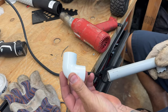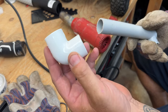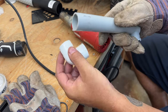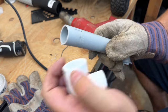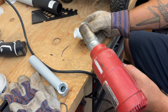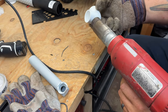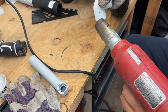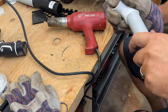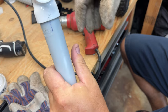Here's what I've got: a three-quarter inch elbow for sprinklers — just plumbing PVC, three-quarter inch. I'm going to show you how to use the heat gun to heat this up and stretch it over here. You can see where our little mark is, so we want to line that up just like that. You don't want it to turn brown, but you want it hot enough to be stretchy. Just line up the line where we marked and you're good to go.